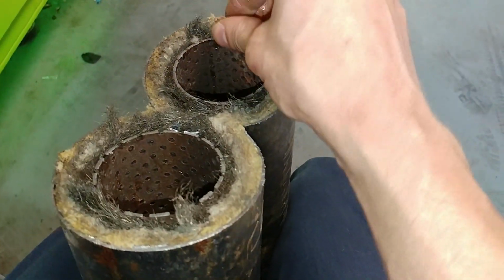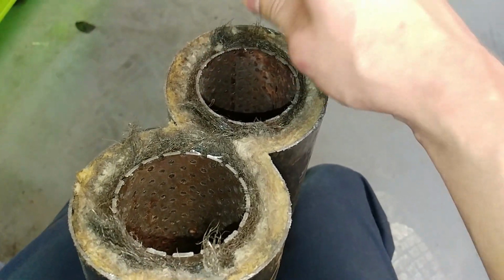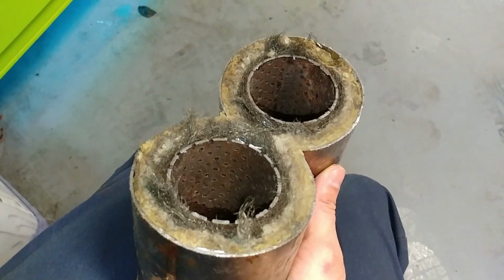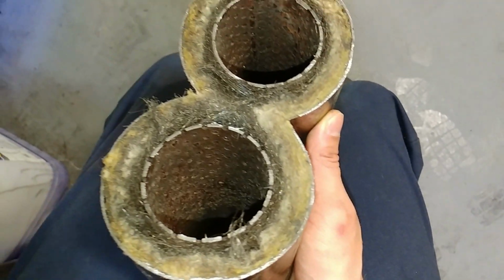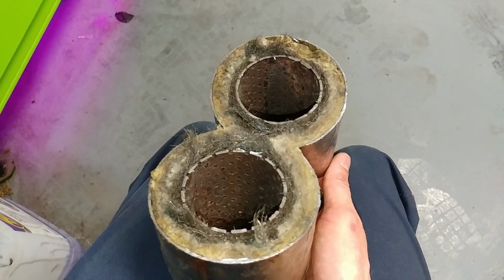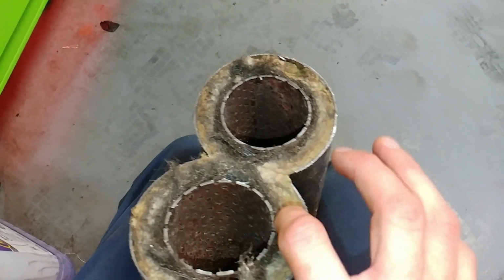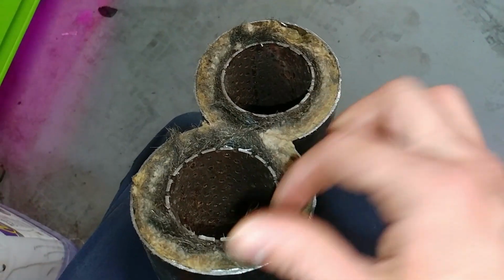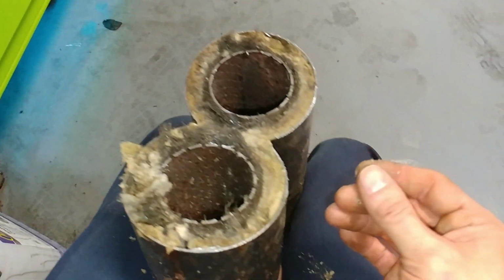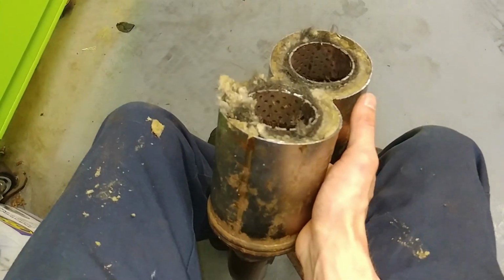But you get to see how they make it. They have, looks like steel wool and rock wool. And this Magnaflow Magnapack has quite a few miles on it, and actually looks in still very good condition. A lot of people complain that Magnaflow mufflers blow out or burn out easily, but this has got quite a bit of packing still, and it's quite tight. I'm going to take it apart a little further. Okay, I'm going to stop right there. This rock wool is really messy, but it just goes to show that the build quality isn't bad. It's just that their customer service sucks.